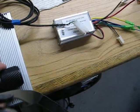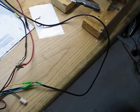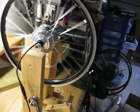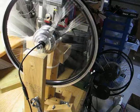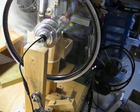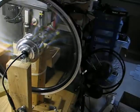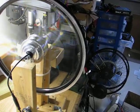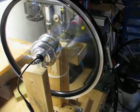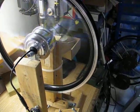We've got our throttle, and here is something pretty special. You've got a smooth takeoff as you can see. Silent, unlike other geared motors. This is hooked up to 48 volts. We're going to bring it up to full power, which will translate to about 25 to 30 miles an hour — probably about 30 miles an hour on a 20 inch rim.